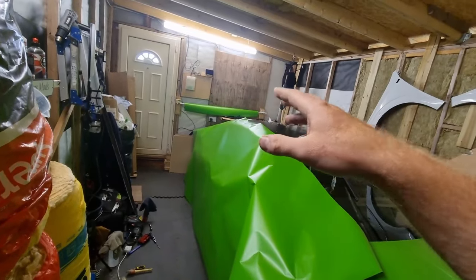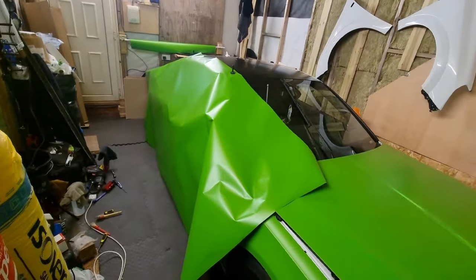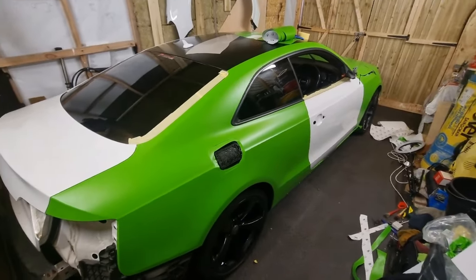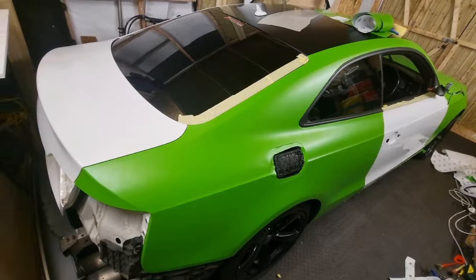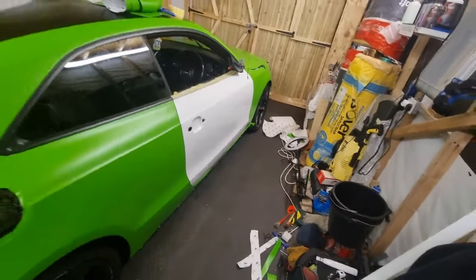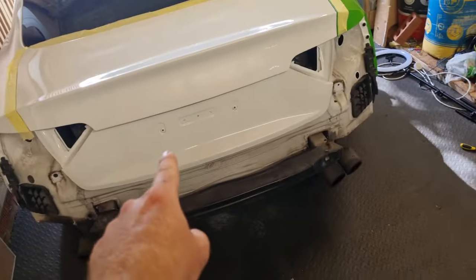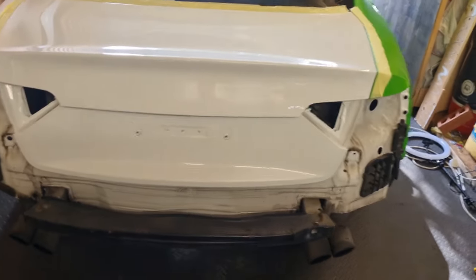That did help a lot, really glad I did that. I do have to watch that the bar doesn't go off either side, but I've got my magnets on the top holding it in place. I'm going to cut off bits of slack, do the door aperture, and use that piece to do the door later on. That has taken me all day - the best part of four hours - but it's the first time I've done it. Got it all wrapped around the wheel arch, all underneath the side skirt, and up over the top. Moving on to the boot lid - I've masked up around the side to tuck it in around the shuts and I've got some knifeless tape under there, because I don't think you'd be able to do that in one piece with all the curves.